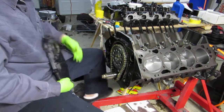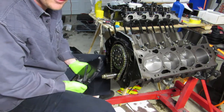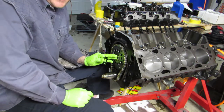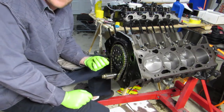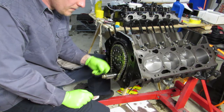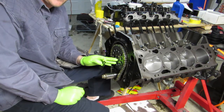It's also important because of the thickness of this chain that we went ahead and rechecked clearance. I put Play-Doh on my bolts and on here, and smashed it down to make sure that I had plenty of clearance for this timing cover — which we do. We Loctited the ones behind it — the retainer for the camshaft — and we Loctited these as well. I would definitely recommend you use Loctite. This lock plate doesn't fit on this bolt pattern. I've seen people drill these out and everything else. I'm not doing that — I have full faith in this Loctite. Definitely do not use engine oil; use Loctite.